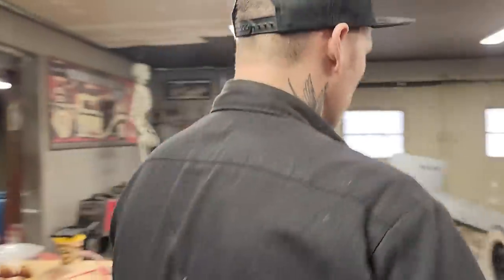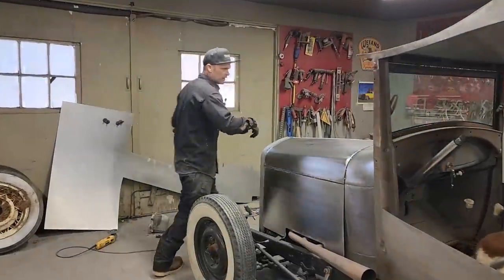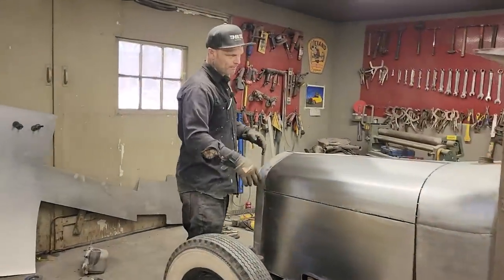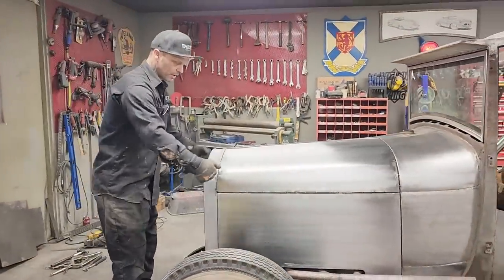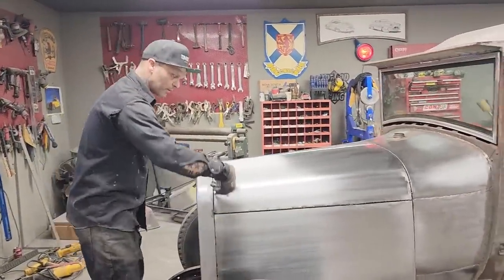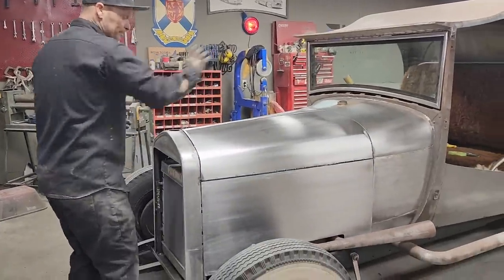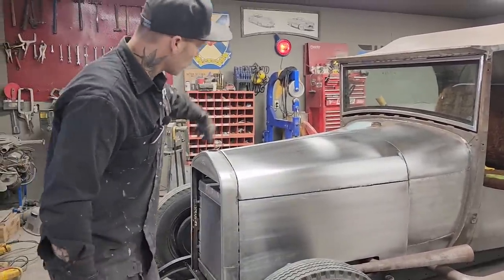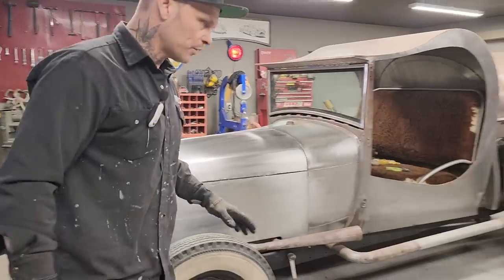It might boing out a little bit, but I'm hoping where I've welded it all up. I said I wasn't going to weld the center. I did anyways, just because it was there. I welded all the edges up. I did not grind the edges, but I just held the grinder flat with the flapper wheel, flapped it off flat, flat, flat all the way around, ran the flapper wheel up through the middle, trying to get my peak looking right. Everything looks fantastic. I'm really happy with the shape of it.